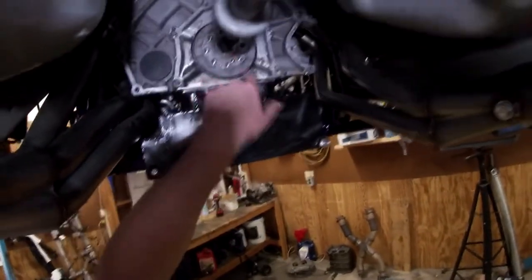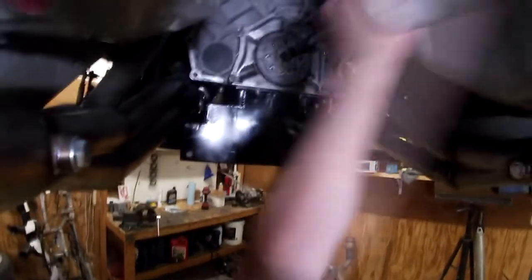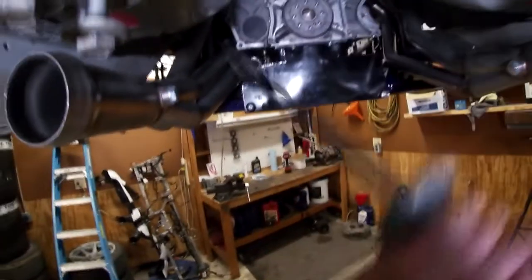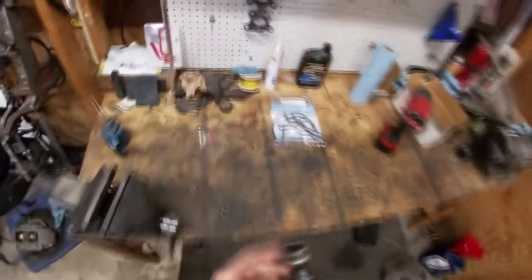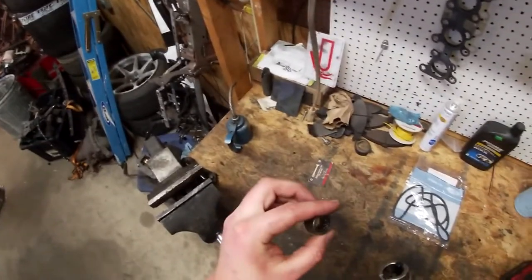Get underneath the little sleeve for the last piece of this bearing and slide it out. It's actually got a couple little grooves in there where you're supposed to put the tool, but it didn't want to grab on the other side. That stinks, but no need to buy any of this stuff because you can get it from AutoZone for free.